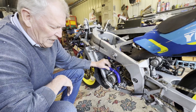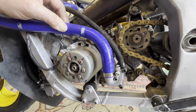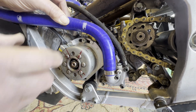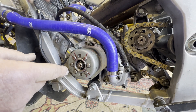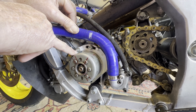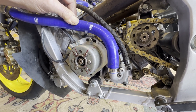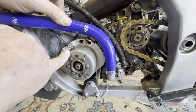We were roughly 25 degrees out on our timing. The only way to alter that - you can't alter it on the computer or in the ignition, you can only alter it by just a few degrees, not 25 like we needed - so we had to make a new backing plate. We put the motor on top dead center using a dial indicator through the plug, put it on top dead center, and then worked out where our pickup and lobe is on the flywheel compared to the pickup point of triggering.